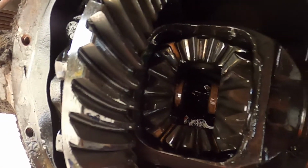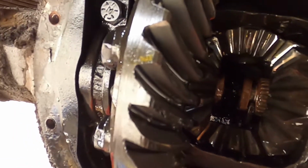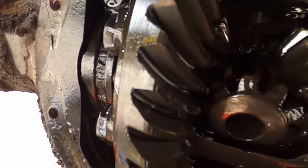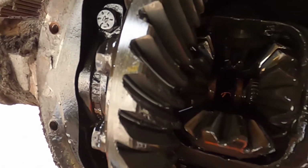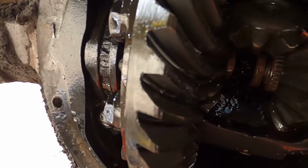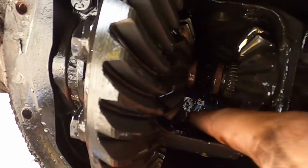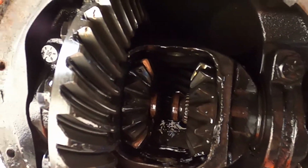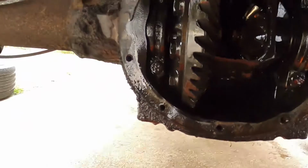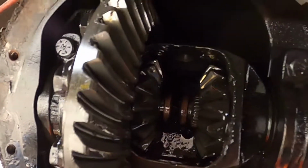Inside of here, make sure we got the axles pushed in. See, we just shoved that axle in and it dropped the C-clip right out of there, and that releases the bottom. Rotate the axle around, and there goes the top one. You reach in here and get the C-clip. We'll need that. Push in the other axle, and the other C-clip.